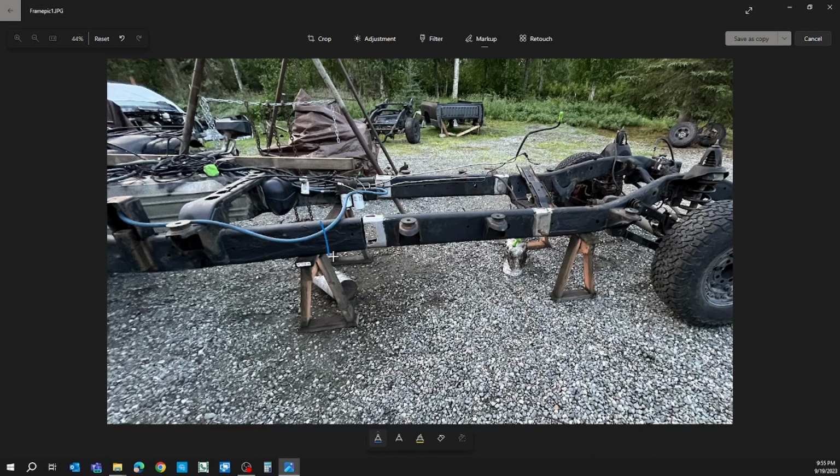about 8 or 9 inches back here and just really cleaned the outside, got off all this undercoat and everything else, ground and sanded it down nice and pretty and polished. And don't be afraid to take a little extra material, especially off the front section there. I mean, the frame itself is only 1/4 inch thick material, so I'm not saying take it down an 1/8 of an inch or anything, or even a 1/16. But it doesn't hurt to just really clean this down and grind it down a little bit, just to help yourself as you slide this in, because it will start to get tight as you get it closer to the end of this pocket here.